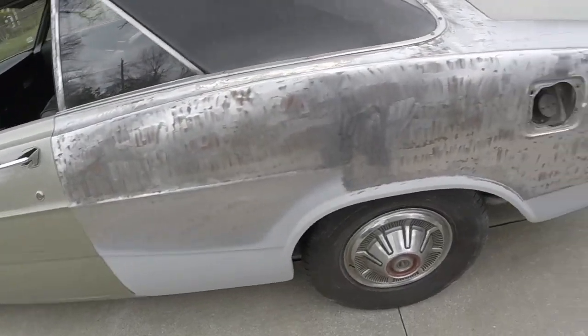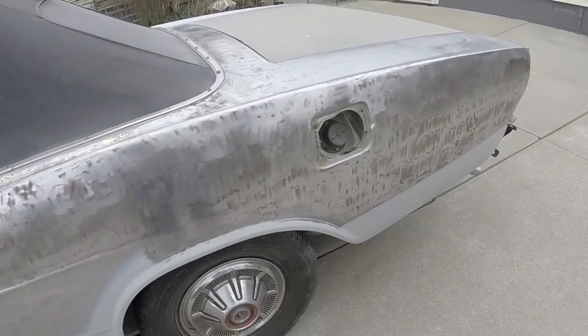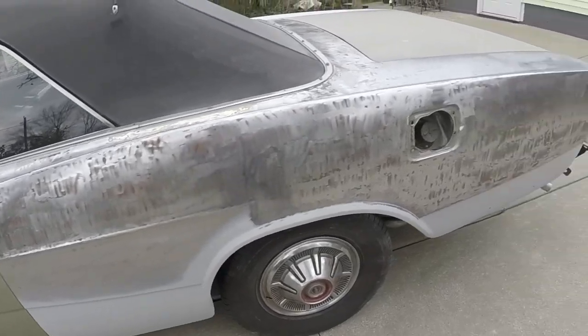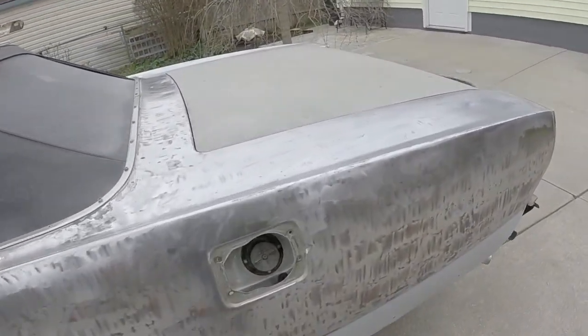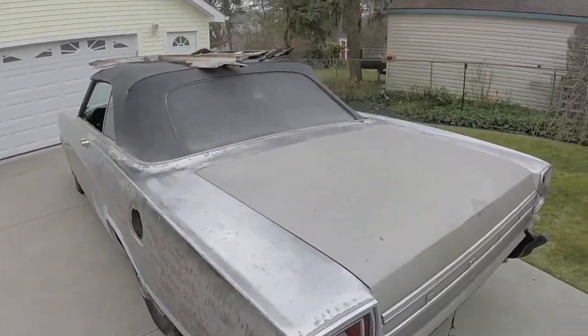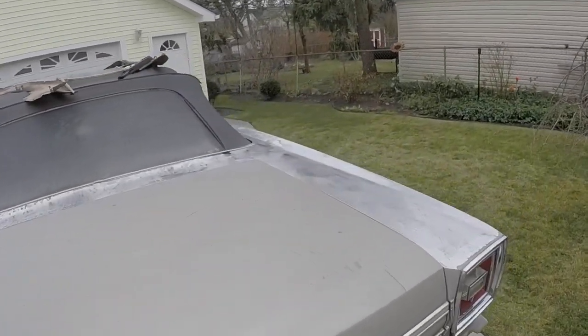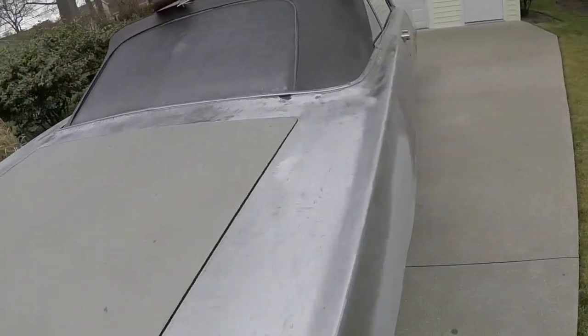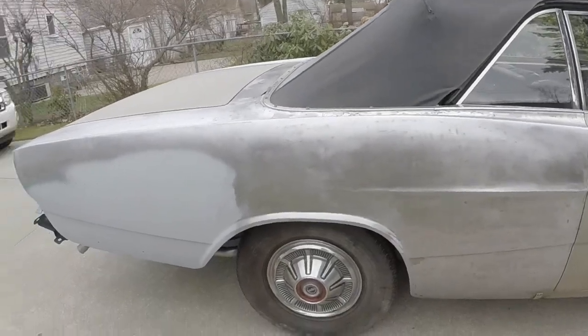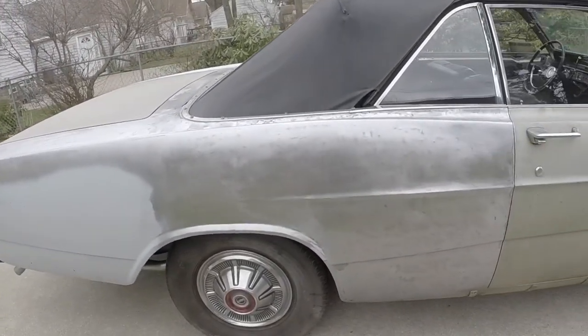And I got the paint. I just used the angle grinder with the paint stripping disc, and didn't DA it because it got really cold out. My DA, when you release air, it frosts and causes moisture. My DA was frosting up because it's about 40 degrees. It started at 63 when I started working on the car. But anyway, I'm going to pull it back in the garage.